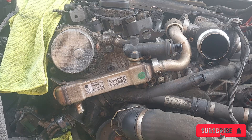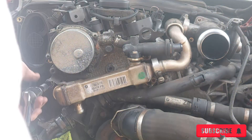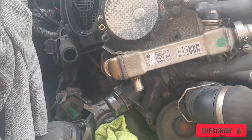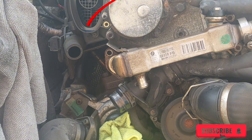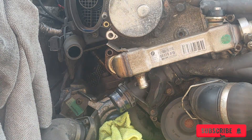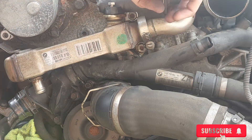Here's the EGR valve. There are two bolts in it — I think they're T30 or T40, I can't quite remember. Before removing those I also had to remove a part of the air intake, a little plastic piece. Once those two are off, there's one more bolt on the left-hand side holding the EGR valve in. The other side has an H7 hex or allen key bolt. Remove all of those and the EGR valve will be loose.